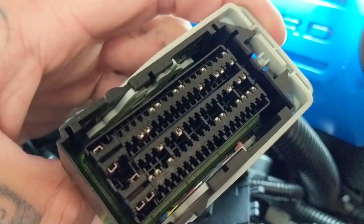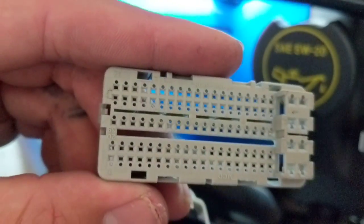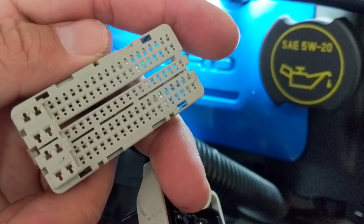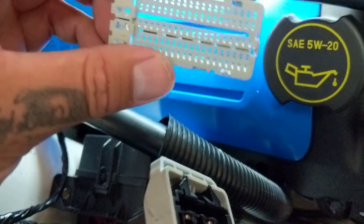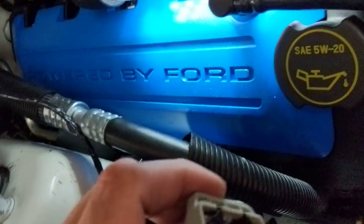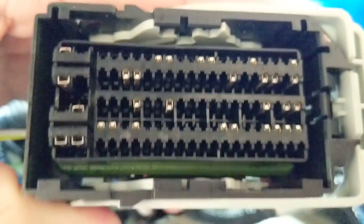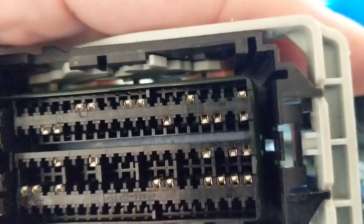Once exposed, I took this cover off. This connector has all the numbers to wire in the select shift — you're looking for the one with 103 pins. There's a good diagram you can get from Ford Racing; they emailed it to me. Powered by the Hour also has one showing how to wire in their specific switch. You're going to be pinning into pin 51 for the common wire, and pins 22 and 23 for the upshift and downshift.